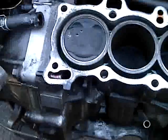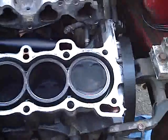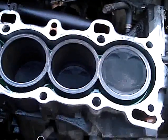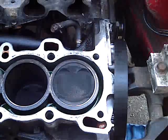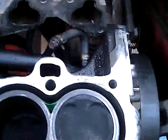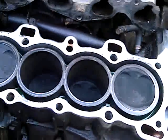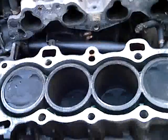So, debunked one — that somebody had messed with my motor at some point before I came into possession of it, and said that who knows, they misaligned something or what have you. So you saw the tit and the arrow, and you're seeing that number one piston is at top dead center. So now I'm going to move over to the head and see if there's anything there I can find that would explain why I'm 180 degrees out of phase and why my motor is running like ass now. More to come.